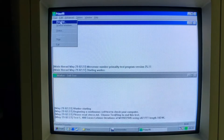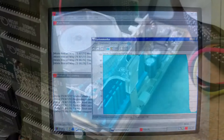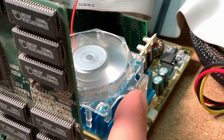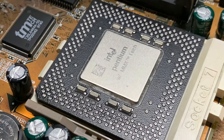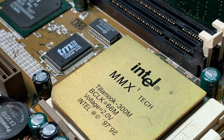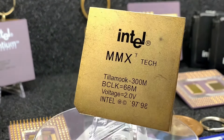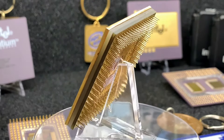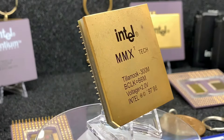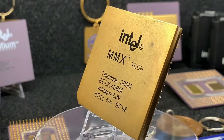After gaming I stressed the CPU for several hours with Prime95. The system was fully stable, and to my surprise the heatsink of the CPU cooler was not even warm. Quite impressive performance. For comparison I also tried a 266 MHz Intel CPU, but that one was not even posting at 300 MHz settings, so I am quite sure that our China-packaged CPU contains a real 300 MHz die from Intel. At the end we have a very powerful Socket 7 CPU with a unique and beautiful package design. Although the package is not original Intel, the design with the heat spreader is well done — this thing definitely deserves the quote 'Intel inside... inside.'